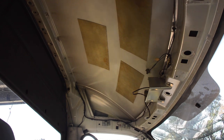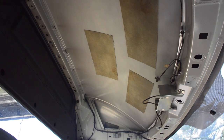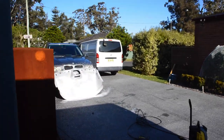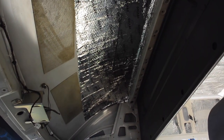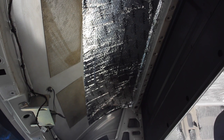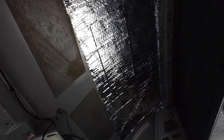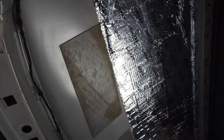We've taken out the roof lining up the front here, and we're going to put foil sound deadening all up through there. It's pretty quiet as it is, but we've got to clean the roof anyway — we've pressure washed it. It's a bit of an afternoon project — a bit of insulation up there. I took the interior cover out to give it a gurney; it was a bit dirty. You just roll it on with a little roller. Got it on eBay — pretty expensive. I shouldn't have got two boxes but I've got two boxes. We'll just have to measure and we'll probably just overlap it, won't have to cut it down.